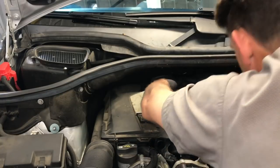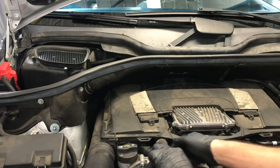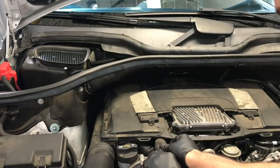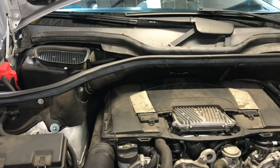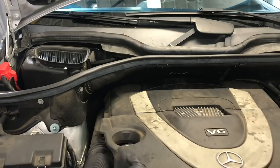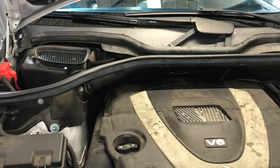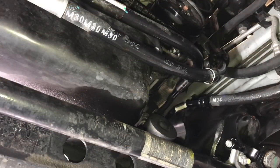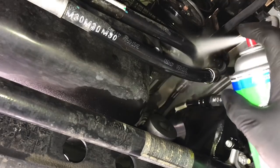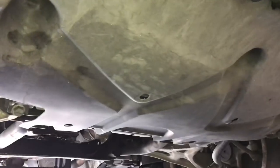Slip the air cleaner on around the mass airflow sensor in the back and make sure it lines up around the PCM. Press it down until it locks into place. Plug the hose for the secondary air injection fresh air inlet into the air cleaner. Then put the front engine cover on — it lines up with slots on the front, just push it on and down until it locks. Before putting the lower shields on, spray everything down with brake cleaner to wash off any remaining power steering fluid runoff. Wipe it down with rags, then put the shields back up.